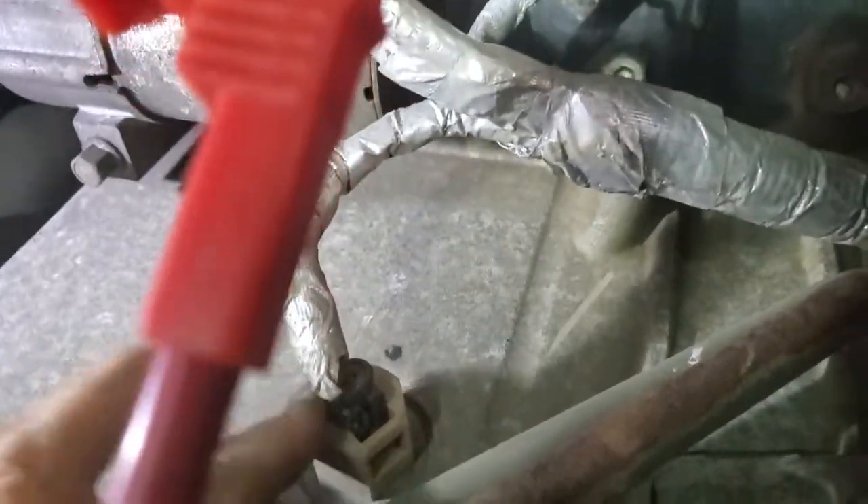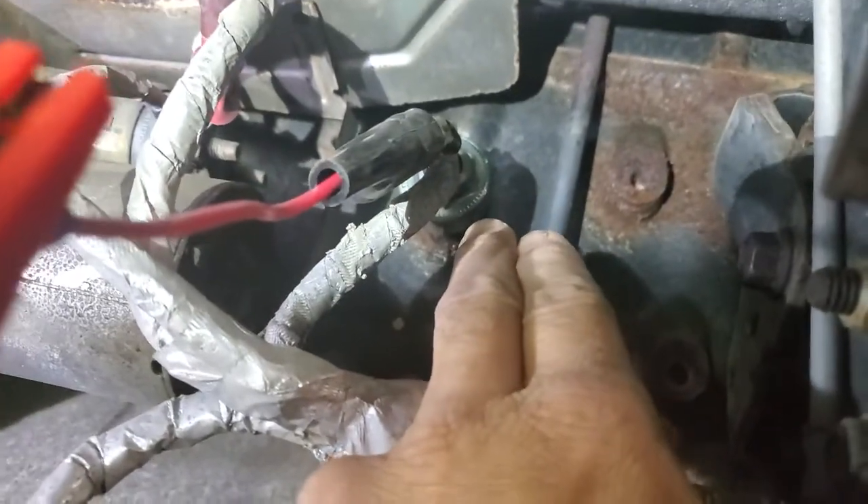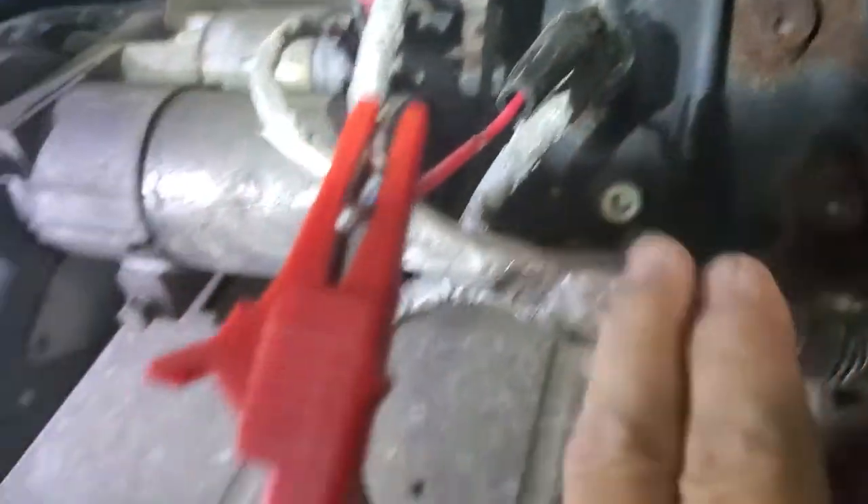I just want to teach you how to test that. We're going under. Here we are — remember there's the sump, the oil pan, the part that comes down. That's the oil level switch indicator, how much oil you've got in there. That's the knock sensor right there, that little silver can. We're on the light blue wire, hooked up to a voltmeter.